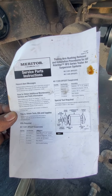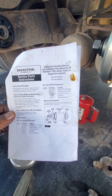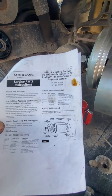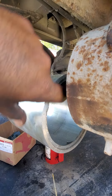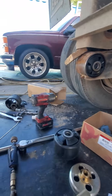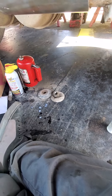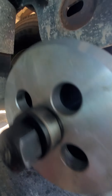Another thing I forgot to mention: each bushing comes with a set of instructions on how to use the tool and how it should be set up. Now you can see I just cleaned up those burrs so I don't mess up my tool. Before you start extracting, you want to make sure this is nice and lubed — whether it's soap and water as the instructions say, or what I'm going to use is some of this stuff left over from the other bushing. It slides real nice. Everything is all put together — remember to put lube inside of there.